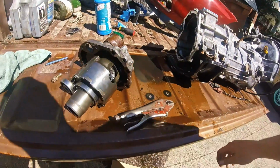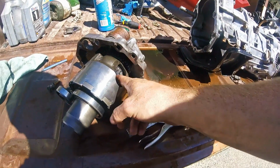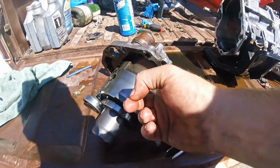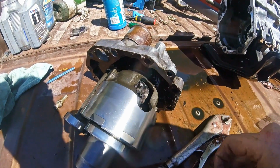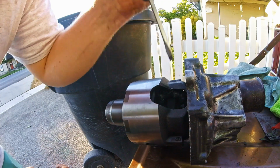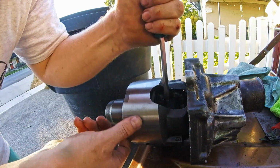So now I'm going to spend some time with a pick and a screwdriver, and just jam it in there a bunch and make sure there's no slag that's going to come off. Like here's obviously some big chunks of slag. Anyway, take it in there and clean it off. So you just kind of jam it down in there a bunch, and since this one's magnetic, it pulls up chunks, which is even better. Some of them will just drop straight through, which is nice.